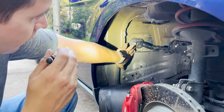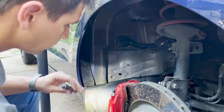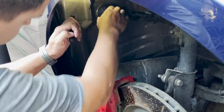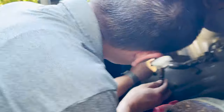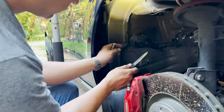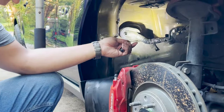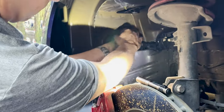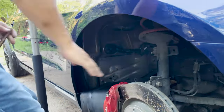Okay, so with this pulled down, we can see the grommet from the other side. We just need to safely poke a hole in, right in here. I'm just gonna use this screwdriver here to kinda, probably just cut that off right there and run our wires right through that. Perfect little hole cut right in through. So then I'm going to reinstall this grommet. All back in.